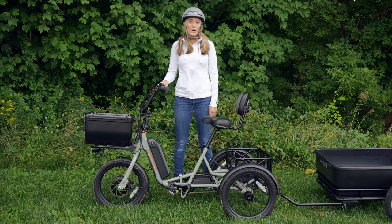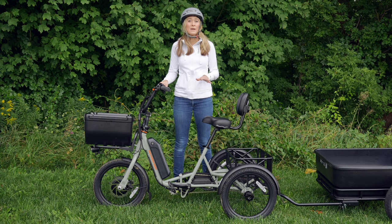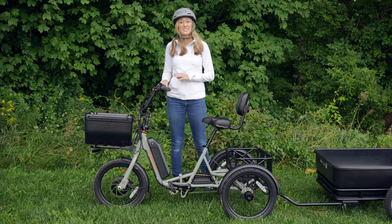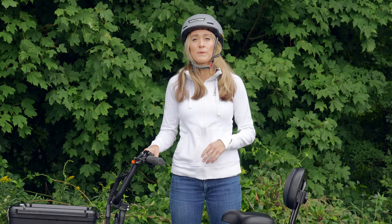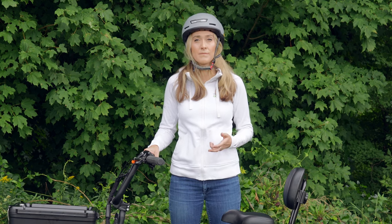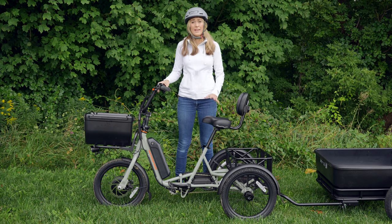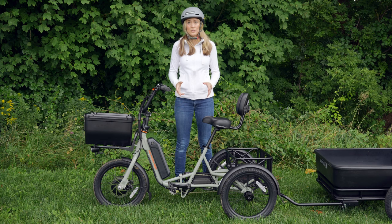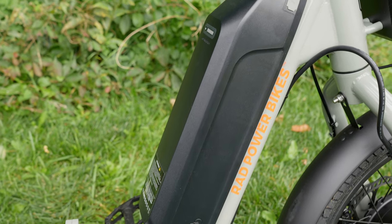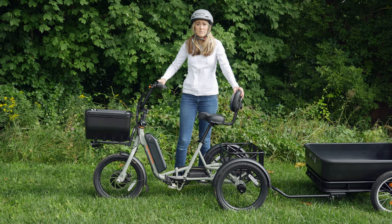Next up is range. I've tested quite a few e-bikes in the 80-pound range and I usually see them with a 700 watt-hour capacity battery at a minimum, and this one is at 10 amp-hours — under 500 watt-hours. I think Rad should be a little bit more competitive here: either give me a bigger battery or give me an option for a second battery. This is especially important for people looking to haul things with a trailer or add weight to the back rack. Plus, this is a trike, so you have more rubber on the road and it's not going to be as efficient as a bicycle. I also wish the battery was UL certified, because a lot of other big-volume brands in the US offer UL certification — it provides peace of mind.